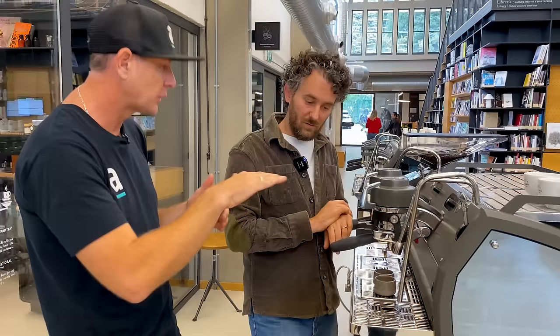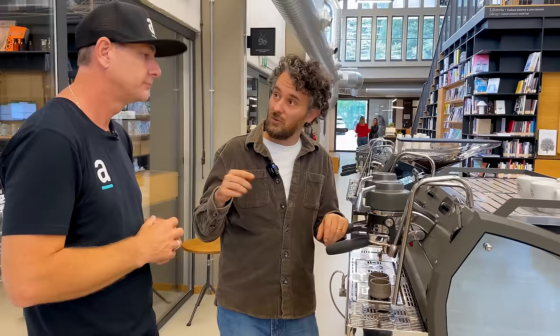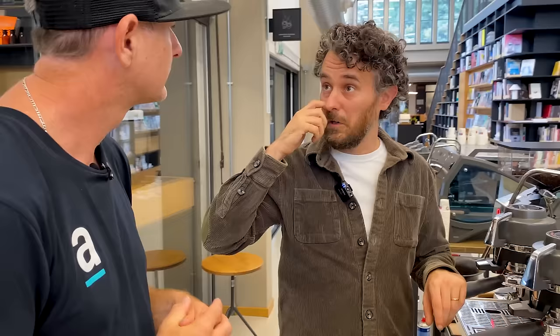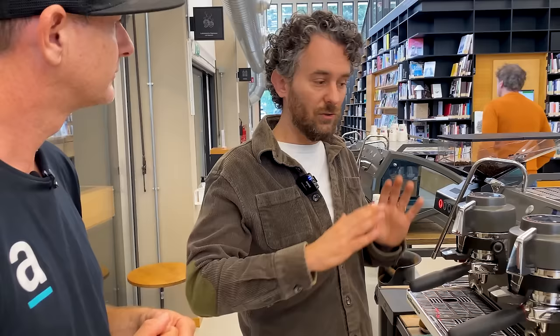If you were using scales, you'd have all the scale capabilities to shut the shot off and maintain the recipe while following the set profile. The big difference in this machine compared to the previous EP is that now the machine doesn't think about pressure versus time, but pressure versus mass. So at five grams of yield you want a certain pressure, at eight grams another, and so on — the machine replicates the whole profile every time.